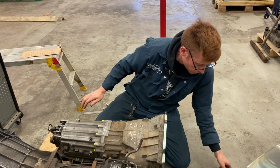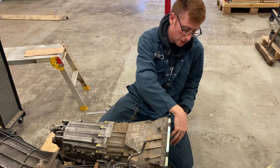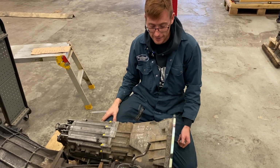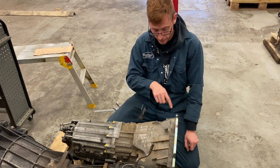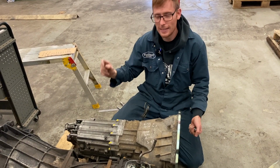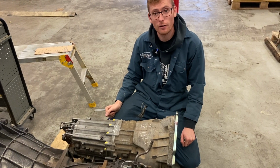Right, so I think that pretty much concludes it. Everything else is the same as normal. You use the normal release bearing, you get everything in the kit, the bolts, etc. I'm not going to put all this together because it's really quite self-explanatory, but on that cutout, make sure the bolts go in the right holes. The Sachs Racing pressure plate is going to give you 600 horsepower of clamping force.